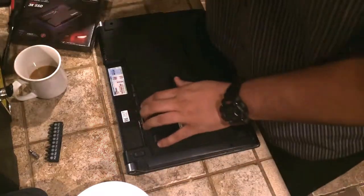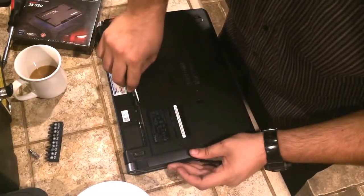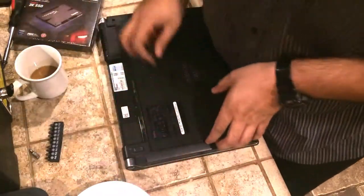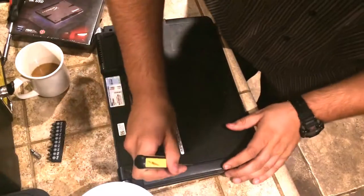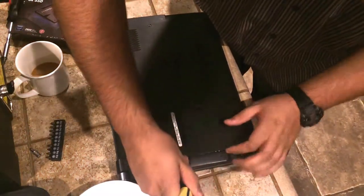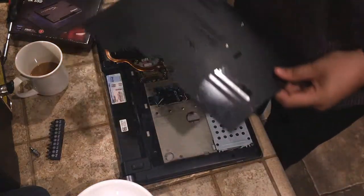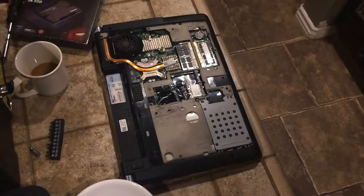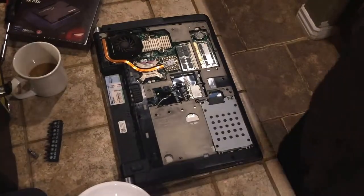After you've taken out the battery and powered down, go ahead and take off your back cover. As soon as I can find a groove I'll slip my screwdriver in. I need a thinner screwdriver — there we go, that one should work perfectly. You should be able to pop your back plate right off. Keep it in a safe spot; if there's any chance of it tipping over, take out all the screws and put them in a bowl.